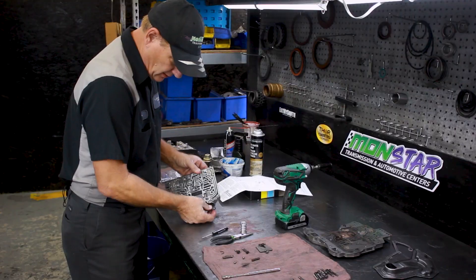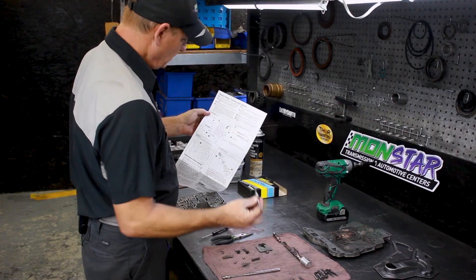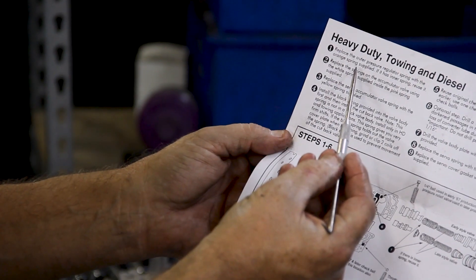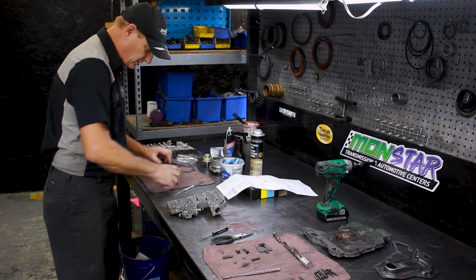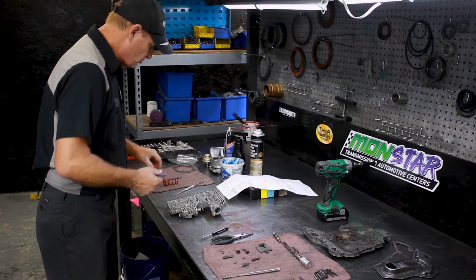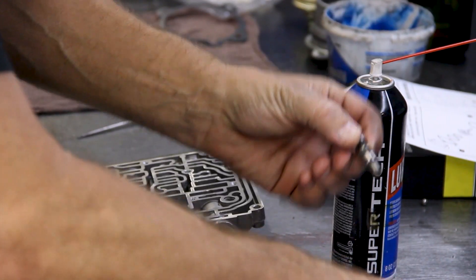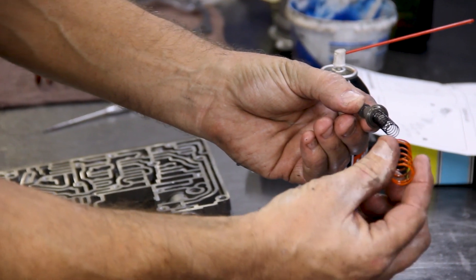We take the boost valve out — there's a spring, actually two springs. This is the order of the boost valve circuit, also shown in the diagram. It covers both the early design with the plate and the later design with the clip. Following step one, it says to replace the spring with the orange spring supplied in the kit. There are different spring sets for normal duty versus heavy duty applications, and the kit contains more springs than you'll use because different springs suit different applications. We're following heavy duty, so we're installing the orange spring to replace the old black one — the black one is discarded. The orange spring is a little taller. There's a shaft that fits inside the spring and goes into the bore, and the mechanism with the new spring and the outer spring goes on the outside of this assembly.